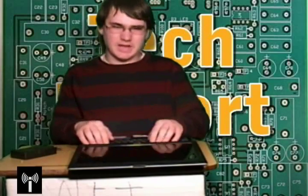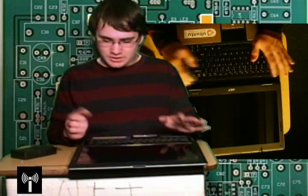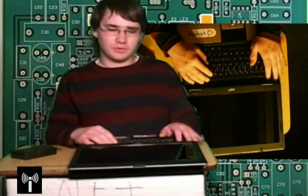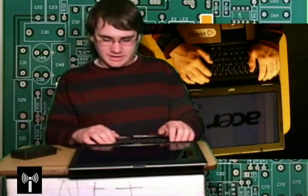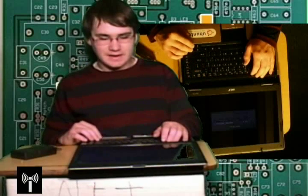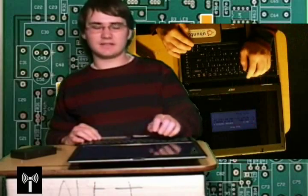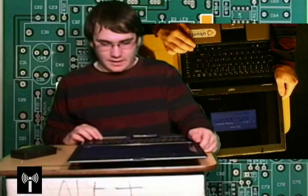Now we've got to test the hard drive to make sure it works. Now that you've got your laptop's hard drive installed, put your battery back in or plug it in, and we're just going to test it to make sure the hard drive is being detected. Turn it on and it's going to boot up normally. What you want to do is get to the BIOS screen — as you can see I'm pushing F12, which brings me up to a menu like this. This is my boot menu — a list of boot devices, either the CD-ROM drive or the hard drive or network boot. I just want to make sure my hard drive is detected. I've got it highlighted right now. The IDE hard drive basically means that all went well — my computer is detecting the hard drive. So now I can go on and install my operating system.